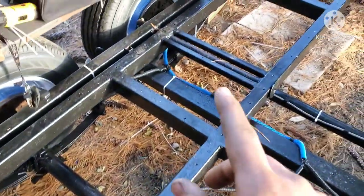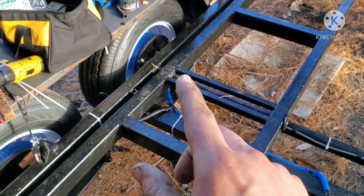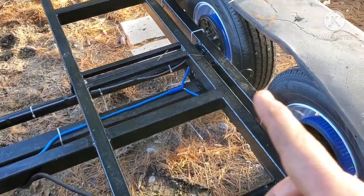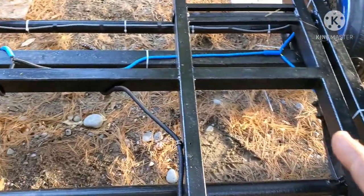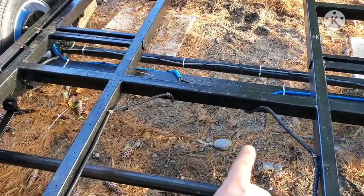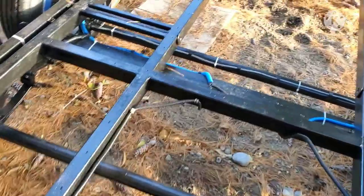All that stuff. Trailer brakes are wired, adjusted, and the magnets all work. We backed the truck up and tested it. Tucked all the wires up nice and neatly. I mean, it's not pretty, but you're also not going to see it. So other than this stuff here, you're going to see that because this is all open.